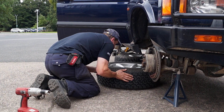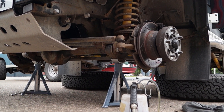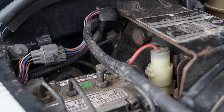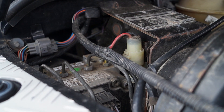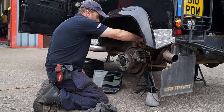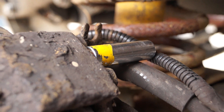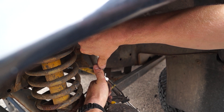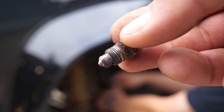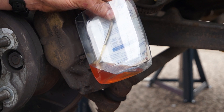We're going to skip between a Defender and a Discovery, get it up on axle stands, and bleed it out properly. We have standard axle stands for cars on level ground — there's no need to put the handbrake on since the wheels are off the deck. For reference, here is your modulator valve, which you do not have to touch externally. You need an interface, a spanner, and make sure all your bleed nipples are free — sometimes a socket is more helpful than a spanner. You can see by the flow that there's a fair amount of power and the fluid gets pushed at a great rate.